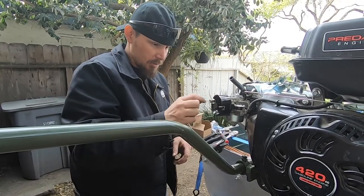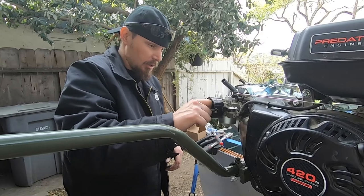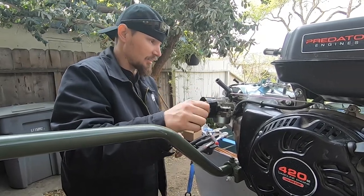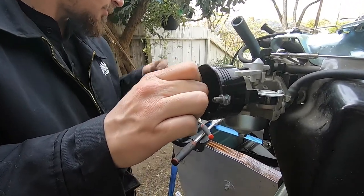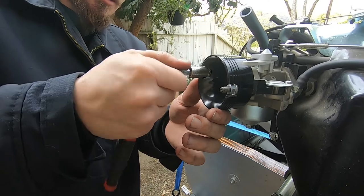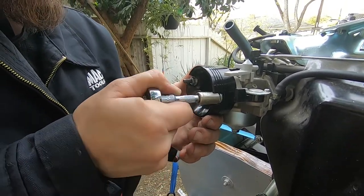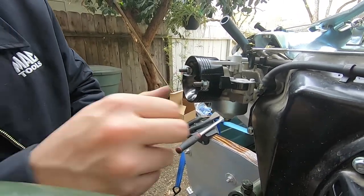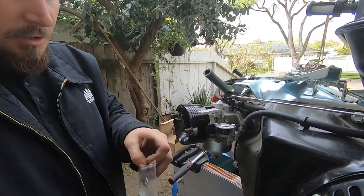That's kind of weird — I don't know why there's so many hiccups in this kit. I was hoping this would just be a quick install. The exhaust pipe isn't their fault, that's the motor's fault because I can't get the studs out — but I was expecting this spacer to fit nice. Let me grab a 10 millimeter deep socket. This works — barely. Alright, we're going to tighten this up. This is a really nice spacer though, I gotta admit. Alright, spacer's on there, ready to go — she's gonna get some more air.